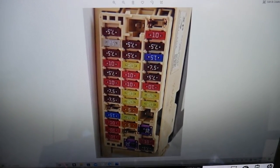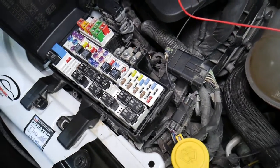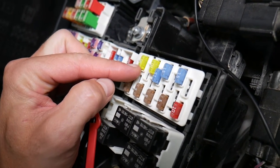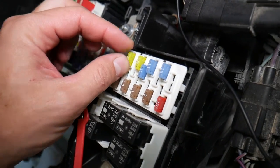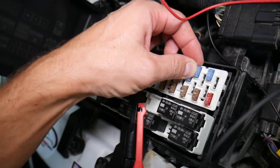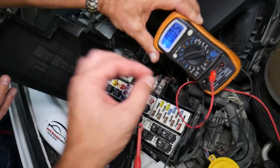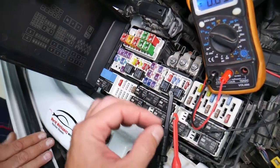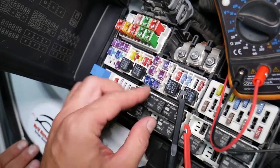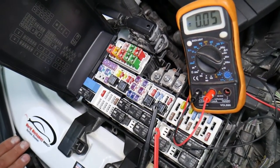Before we continue, let's explain why it's important to test fuses and relays. Often you cannot see whether a fuse is burnt or good. Sometimes they may seem perfectly fine, you think it's a good fuse, you put it back in, and you end up spending money and time on parts and problems that do not exist, when all you had to do was test your fuse, find out it's bad, replace it, and fix your problem. We will have a video on how to test a fuse, different kinds of fuses, and how to test relays. We're going to put the link in the description of the video below.